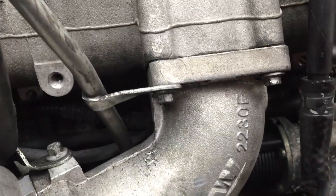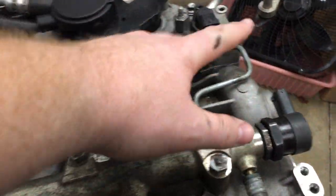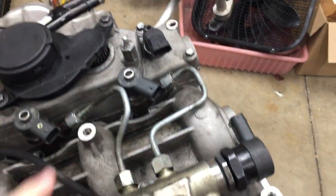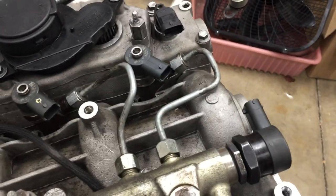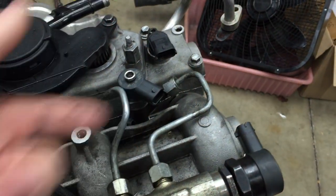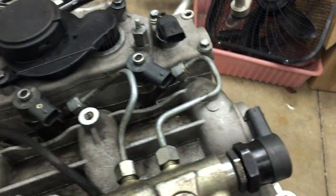So that's your fuel system. If you've got a no-start, there are a couple things to check. If you just did some work — like you had the injectors out or things unplugged — there's a really good chance you've swapped those two plugs. I've done that a half dozen times. But if your Jeep just stopped running while you were going 80 miles an hour down the highway, that's probably not your problem.